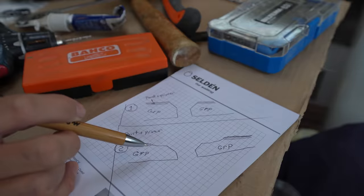Before I start laying up glass I'll apply tape to the back and fill this void with a little bit of thickened epoxy. If this was a structural repair — maybe something like a hole from a through-hull below the waterline — then I would do a much more involved process of grinding a bevel on each side of the hole in a ratio of 1 to 12 and lay up solid glass to fill up the thickness of the laminate. I'll include a link in the description for a PDF that describes this process. But for these tiny holes, I think this much faster method is going to be just fine.